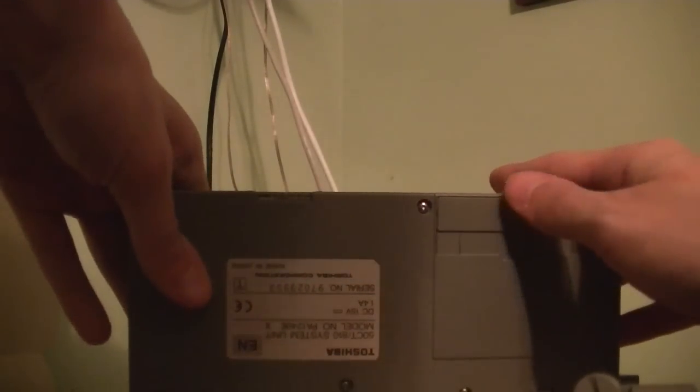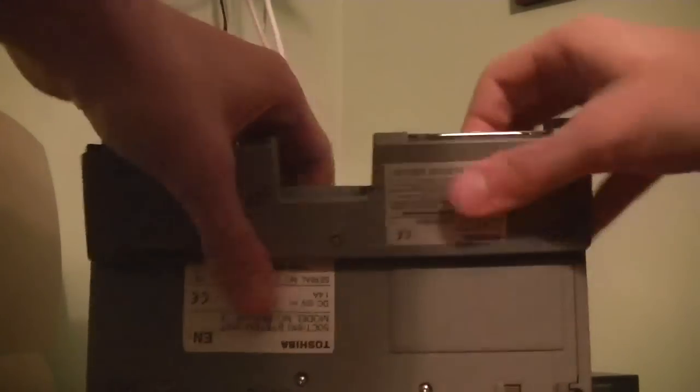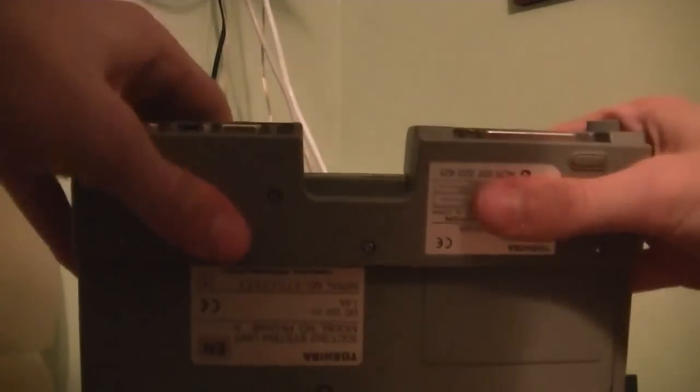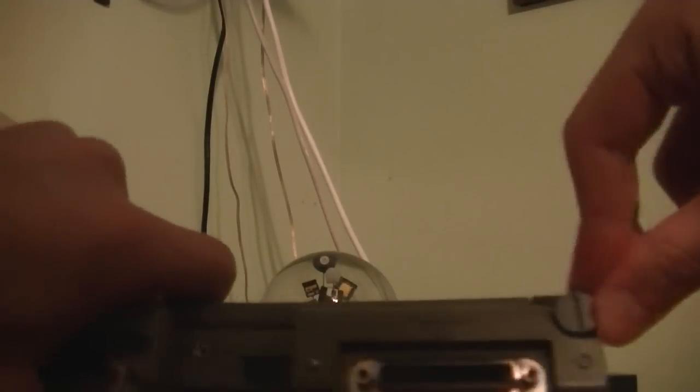Okay. Live television here, folks. As they say in the business. Okay, you take your I.O. adapter, but first you need to reach to the bottom of the computer and slide this down. And that's where you connect the I.O. adapter into. And then just line it up right, for one thing, and okay. It's usually easier when you're not filming. Okay, and it's in, and then there's these little thumb screws. Just screw them in with your fingers, nonetheless. And voila, you now have extra connections.